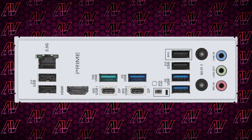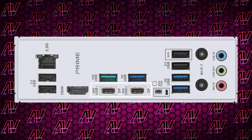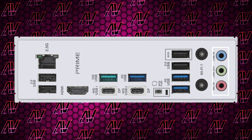Turning that thing around to look at the rear I/O, here we do have eight USB Type-A ports, which is a pretty decent number this generation and about in line with what others are doing. At least you also have two full-speed 40 gigabit per second Type-C ports, which I've loved seeing. Add to that HDMI for integrated graphics, 2.5 gig Ethernet and Wi-Fi for networking, and unfortunately just three audio jacks with no optical S/PDIF — which I'd say is just completely unacceptable in this day and age, even if not many people need that many audio jacks.